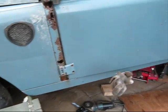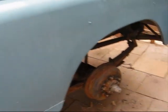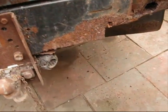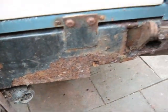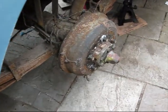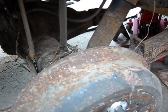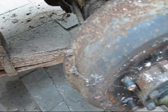This is a bit more of a close-up run of the stage 1. Very badly corroded, but this is the rear chassis cross member, which will be coming off, which is all going to be replaced. Just took the wheels off at the moment, and I can tell you the back section when I get it off and expose it. I've just got a cut about here with the reciprocating saw, and I'm taking the axles out, springs, whatever. I'm going to refurb the springs.